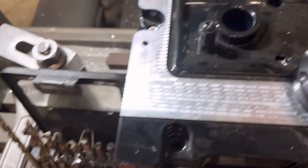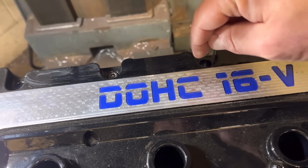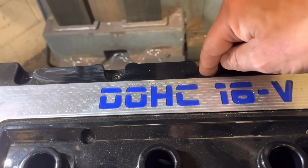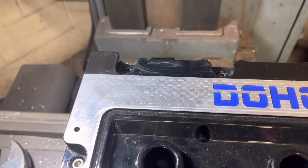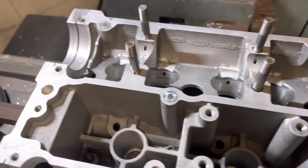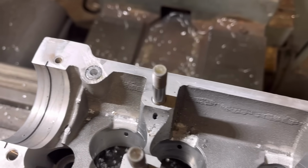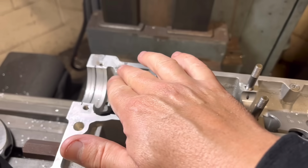And then I've used a 7.5mm drill, which is the clearance size for these M6 holes here. I've used that 7.5mm drill to centralise the cover where the drill and tapping for the M6 is going to have to go. I've then used the M6 tapping drill, run that down there all the way through my plugs on all 3. Now I'm going to remove the cover and see what we've got, and I'm going to tap them by hand. So we remove the cover now, put it back in the cupboard, nice and safe, and you can see we are pretty much central with those holes in the middle of those plugs, which is good. So I've topped them off and they are dead flush with the top now.